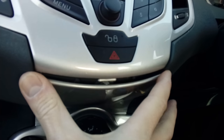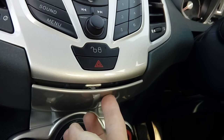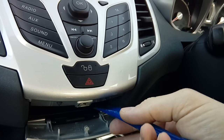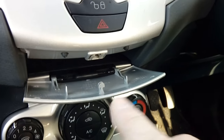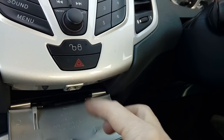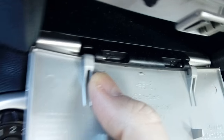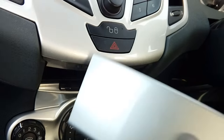First things first, come down to this little panel. This is very, very fragile and there's only one clip holding it on. You can see the clip — there it is — and there's a little metal piece in there that holds it. All you do to get this undone is put your trim tool in and ease it open. Be really careful because this bit can snap off. You'll also find that the metal piece occasionally comes out — just take it off and shove it back into its little slot. It's on really feeble little hinges, so be very careful you don't snap them. Take it off and put it safely to one side — that is the most delicate part of taking the radio out.